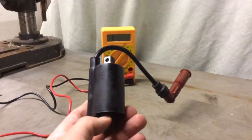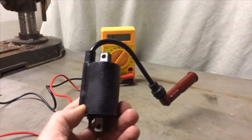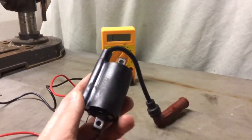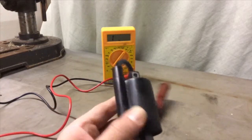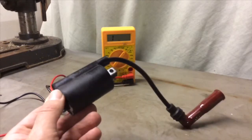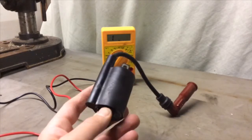That was on the rear cylinder, because when you look at that coil it's absolutely whistle clean, really smooth and unscuffed — and this one isn't. So it looks like I did just replace the rear cylinder coil. It's no surprise therefore that the front one is now suffering from the same problem, because this coil is quite old. I went through my old purchases on eBay and I could see I had only bought the one coil, so that's why this one was failing.